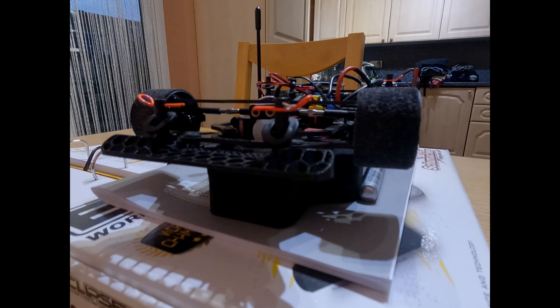The other bits I've been doing is the weight - the car is overweight. So as you know, 730 grams is the weight limit for these things. The chassis on its own, as you see it there with the battery in it, is at 720. So there's a lot of weight there. I can reduce a few things. Firstly, it costs money, but the servo that's in there weighs 33 grams. I've found a better servo at 28.6 grams which is lighter.